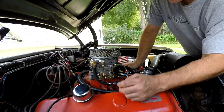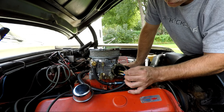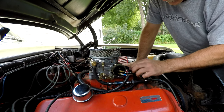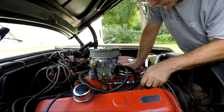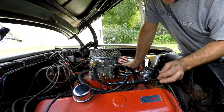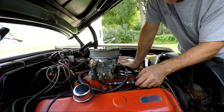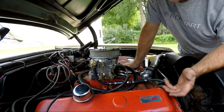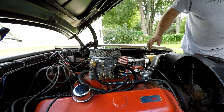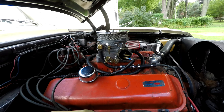Let's hook it all back up. I'm satisfied with this. Some guys might want to leave the 5/8 nut on and screw it in and I would have preferred to do that, but it's a different size. Like I said, I don't want to spend another hundred dollars on just a fuel line to get all the Edelbrock stuff - this will work. As long as I ain't got no leaks. I think everything's back - let's try to start it and make sure we ain't got no leaks.